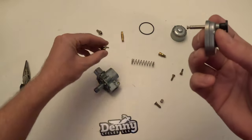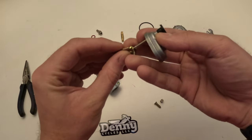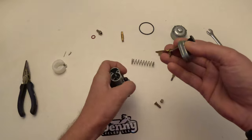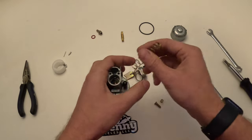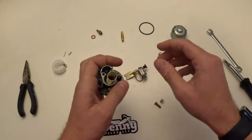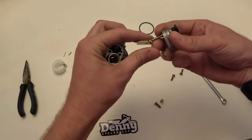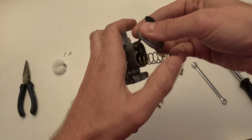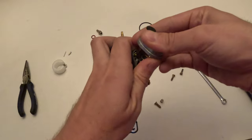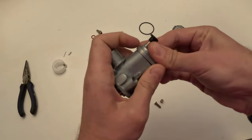Now we're going to move on to installing the spring. To start, we're going to put the choke slide on — push the choke all the way down, put the choke slide on, then put that top gasket up to the top. We're going to start by putting the spring in the carburetor. Now that we have that top piece all complete we'll slide it in. Notice the way that choke slide goes in — the little round shape will face the front.